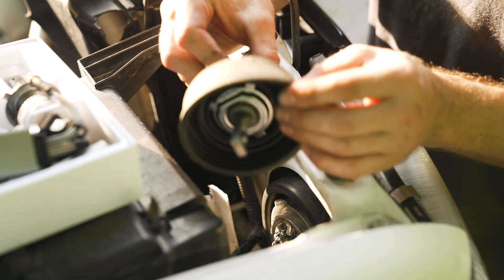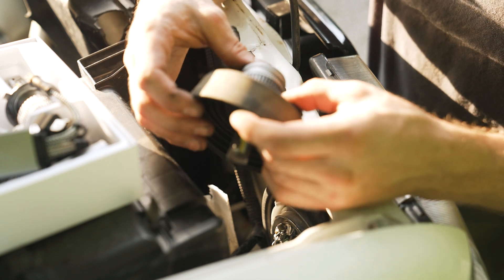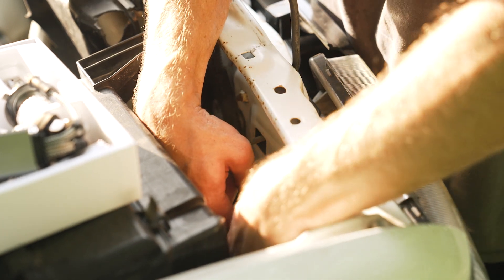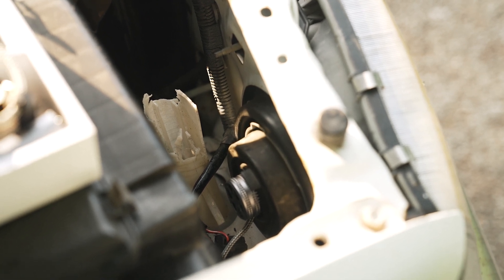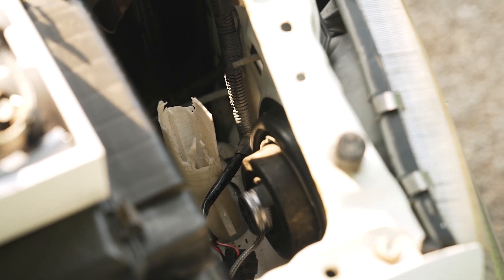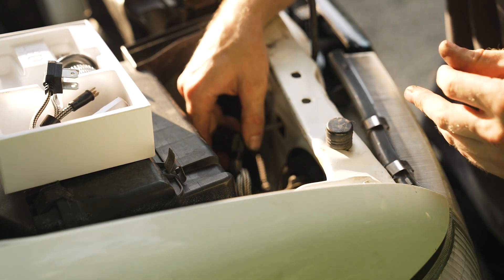I ended up fitting the rubber casing around here — I had to make two slits to be able to fit it over the cooling fan on the back. I kind of want to trim it even more so it can breathe and get as much air as possible. I'm a bit worried that the rubber around it won't allow enough air to get in there, so I may pull it back out and trim it back some more. I've successfully got the LED in there with as much comfort as I can have with the rubber encasing around it. First I have to hook up the little ballast piece to it, then I want to turn it on, do a look over, make sure nothing's getting too hot, and see how it compares to the OEM. I just need to attach one of these to the appropriate side, then plug the factory connector into this connector here, and we should be in business.